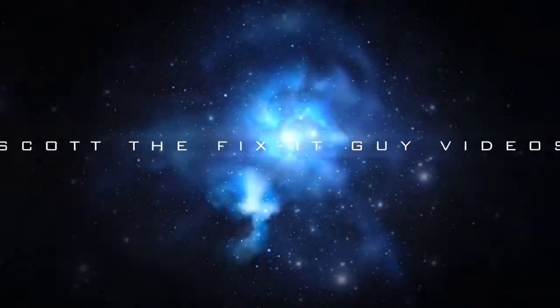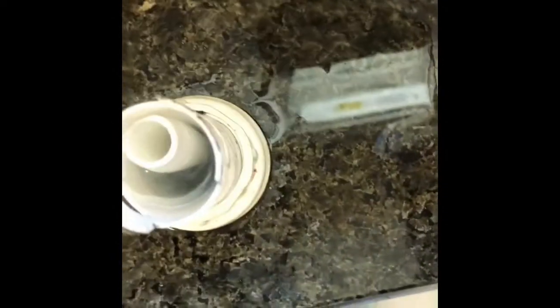This is a quick way to cure the Bosch E24 or E25 drain error. First thing, check the air gap located near the kitchen faucet. Just take off the silver cap and pry off this white piece. In this case, we found some stuff caught in there, which is pretty common. Just pull it out and then see if it'll drain after you put the cap back on.